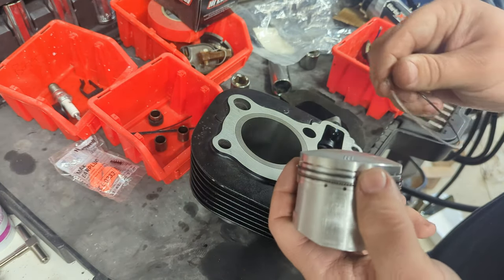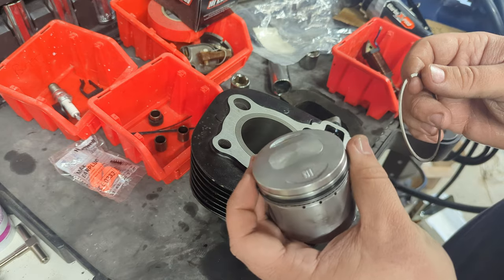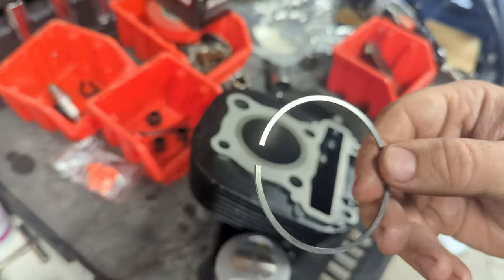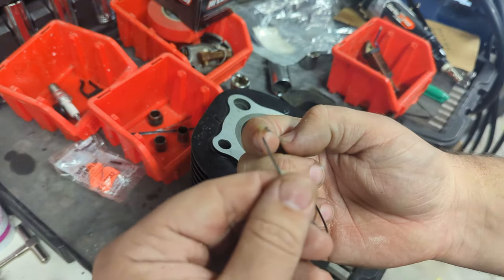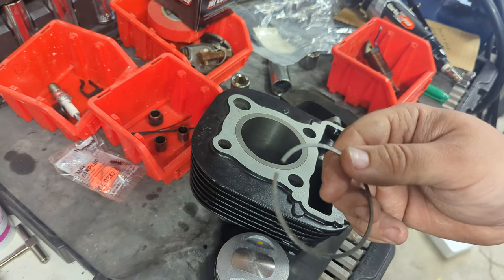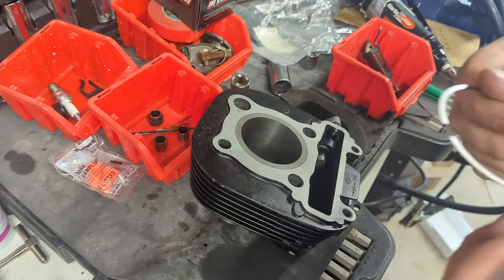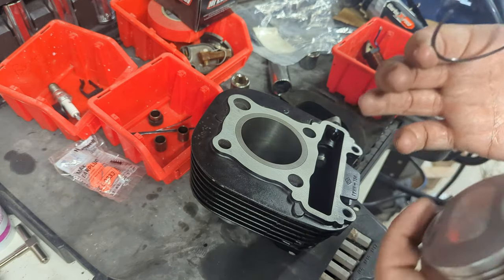As for putting the other rings on: this black ring doesn't have a defined way up, but I've put it with the stamping facing up because that's just the convention. As for the top compression ring, we need to look at it — hopefully the camera will focus. You might just see a bevel on the ring there; we want that facing up. With the bevel facing up, the markings on this ring are also facing up, which is kind of the convention. I've used that to position the other ring as well — markings facing up on both, because if they do on the top one, they probably do on the lower one.